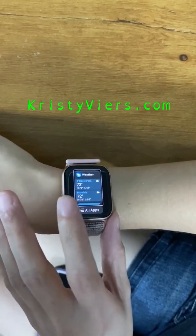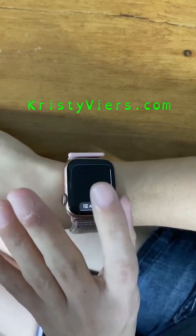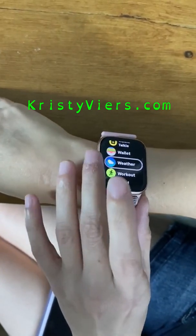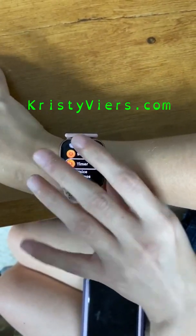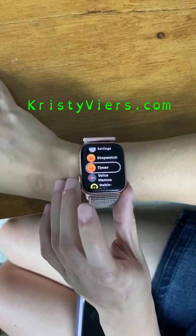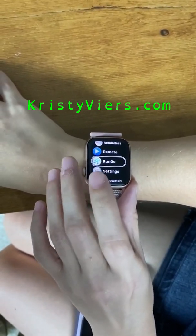When you're done with an app, you just press the side button once. If you want to exit out and actually close it, you swipe down one time, then double tap with one finger and that closes it. There is also digital crown navigation — when you turn that on, you take two fingers and triple tap. That slows down the haptic feedback to one haptic per app, so you can slowly go through them to find the one you want. This might work well for someone new to the watch or who would prefer to count rather than scroll quickly.